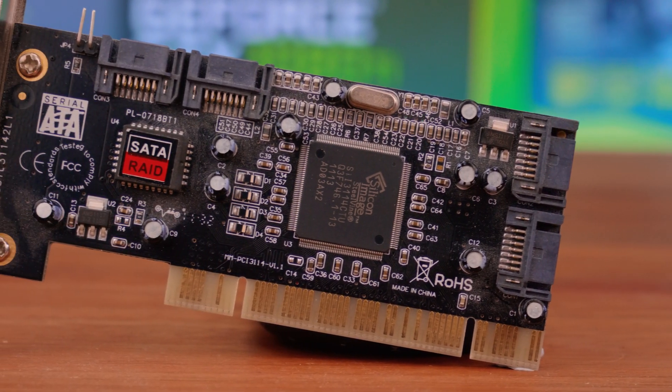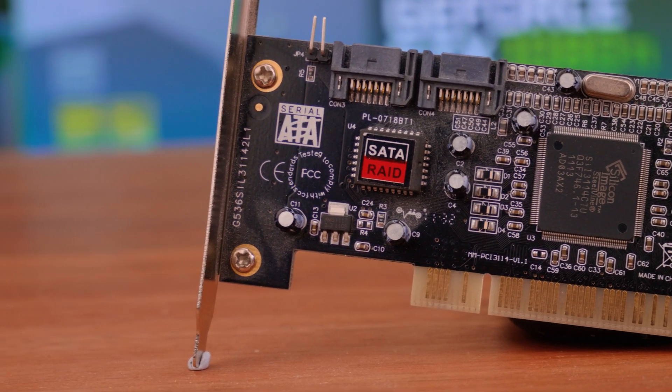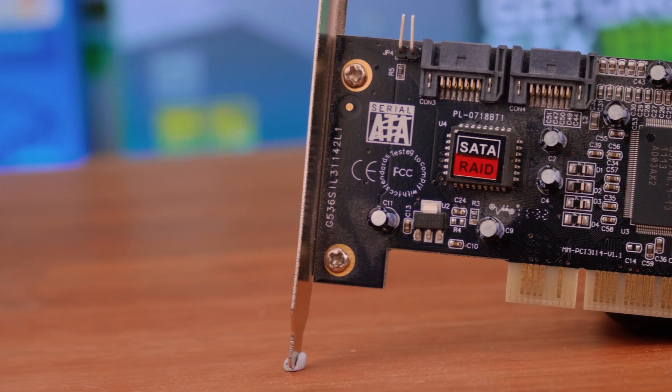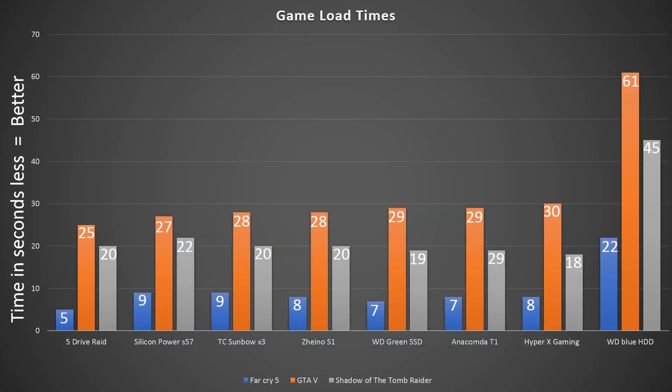People are kind of using them for the wrong reasons. Okay, they're annoying — but obviously they exist for a reason, and that is the large storage market for people on a budget. If we throw up some benchmarks from a previous video where I used the faster 4x version, we see that even with dual 4x cards we're only able to deliver 1.6 gigabytes per second across 10 drives, whereas napkin math says we should be delivering over 5 gigabytes per second.